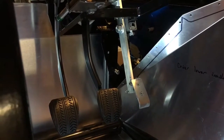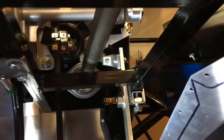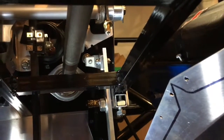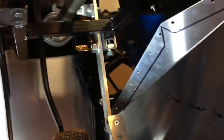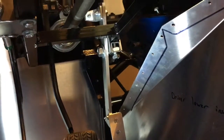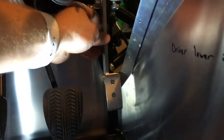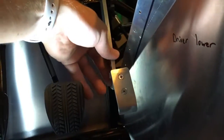Here's how everything looks assembled. In the car you can see I have pretty decent spacing between that brake and that gas, I'm close to the side, and I have clearance at the foot box up on top. Factory 5 does say to cut that in their assembly manual, and I did — that's why you've got to do it right. As far as travel, pulling the throttle cable up on top, it clears that bracket, you get the full range of motion, you're close to the side, and you've got brake pedal spacing.